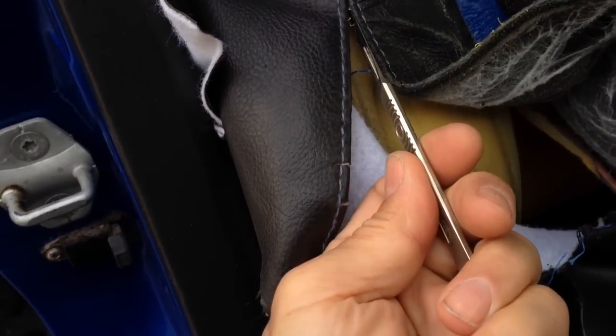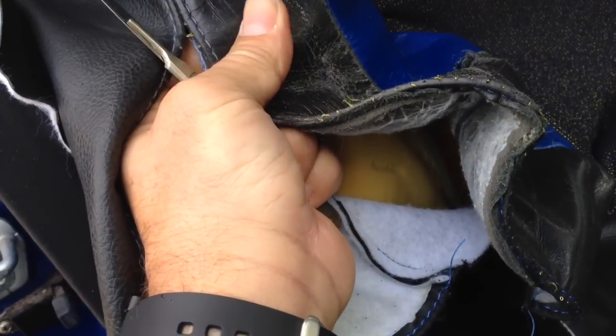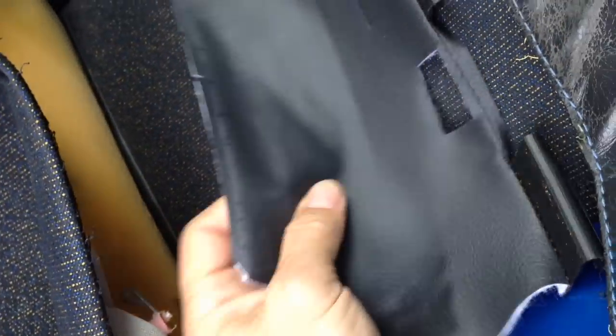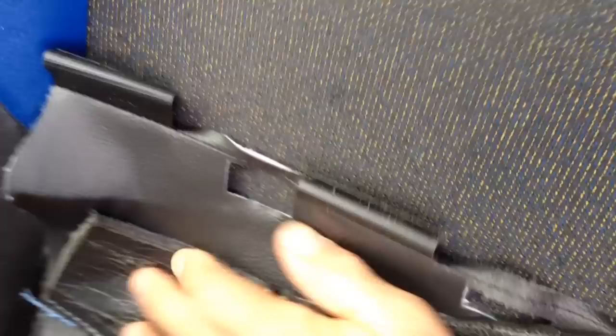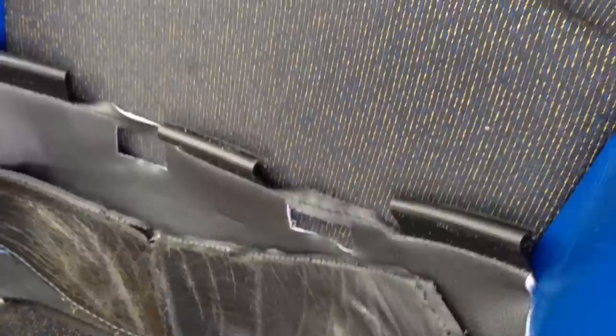Next, take a scalpel and cut through the threads to open up the seams and remove the worn-out patch. We're going to join it at about that sort of height to take out all the worn part. So now we've cut out the leather that's worn out and cut the bottom piece off the seat cover. We can see that's the right size to cut the same size section that we need to refit in there. Possibly with some leftover bits we might be able to patch the corner as well.